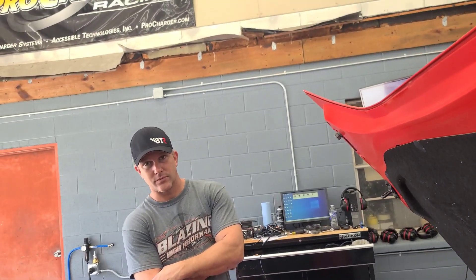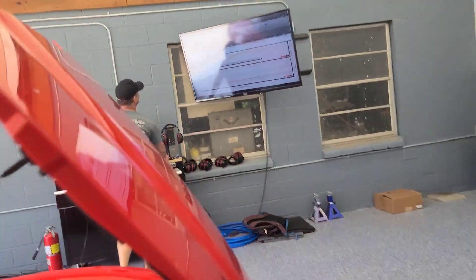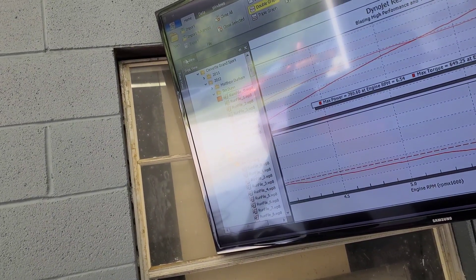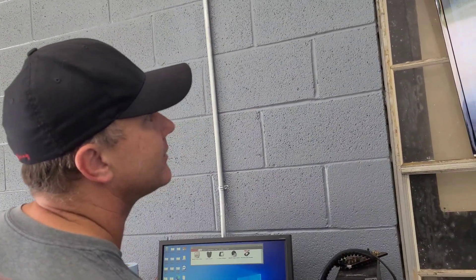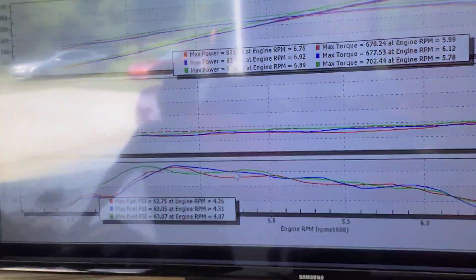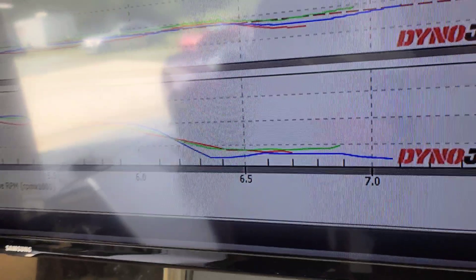E-content was 80% — he had a lot of ethanol. One thing to note about this one: this is a good 800 rear-wheel combo, because we were talking about it being maxed out with the blower and the belt — it's also maxed out on fuel system, and probably the bottom end too, once we get around that 800 mark. We love data, and that's why we added a map sensor that worked, so we could see how much boost it was making. It doesn't slip at all. We did put the fuel pressure sensor on it and log that, and we boost-referenced that also — it wasn't boost-referenced when it got here. We said it's probably still not going to have the capacity to keep increasing with boost, but it did give a little bit of headroom. About 6,300 RPM is all the injector it's got and all the fuel system.